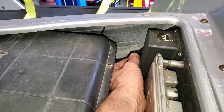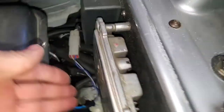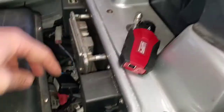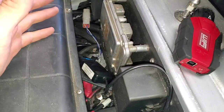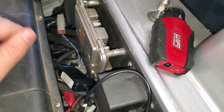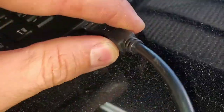This is going to be for the Gibbs computer. There are two different control modules. This one here is from BMW that controls the engine. And this one connects to a module up underneath there on the flat bottom side of this under panel, underneath the battery tray. This is going to control items like the reverse motor, the wheel retraction devices, and there's also a water pump down in here that is controlled by it as well. Then you just USB plug this thing into your computer.